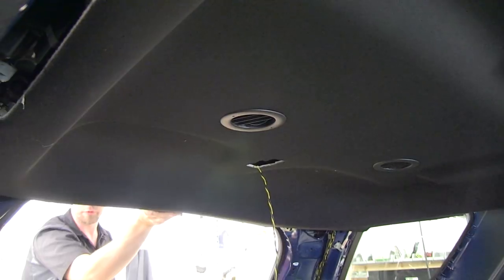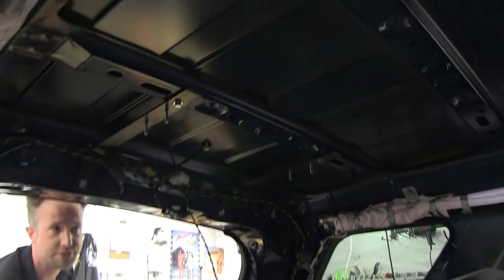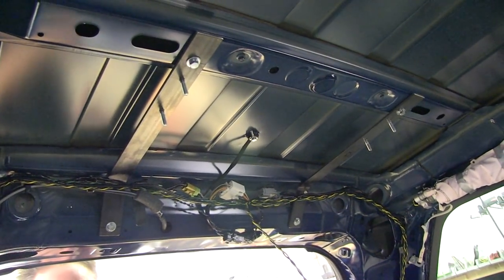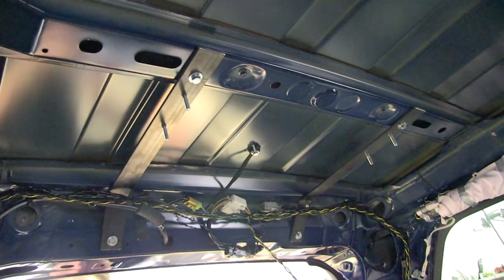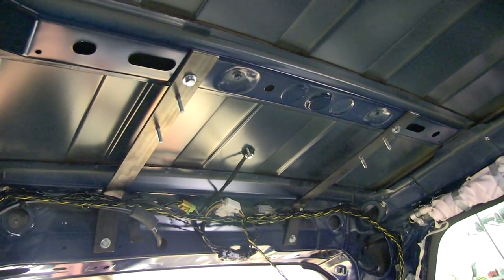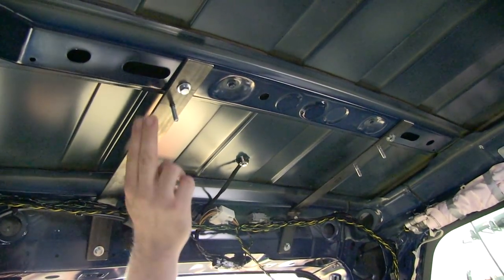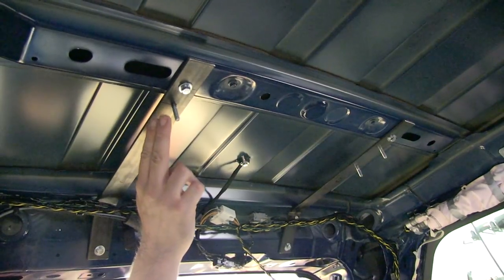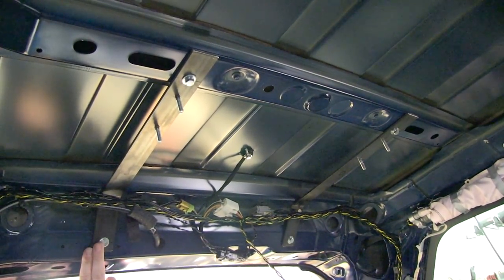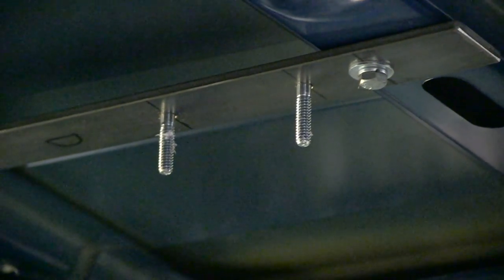In the rear of the utility is going to be a headliner-mounted dual weapon storage system. Affixed on here with custom brackets fabricated by Danny, tying into the Ford interior skeleton for plenty of support for the dual weapon mount and the weapons themselves when secured. Here is a look at the heavy-duty bracket bolted into a rear upper crossbar in the roof and following suit into a secondary bolt point into the rear cargo hatch area, making this a nice simple bolt-together system.